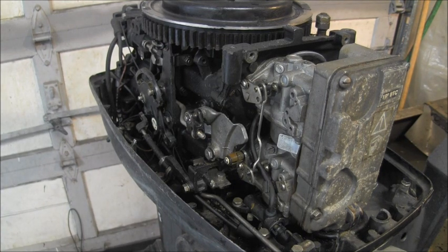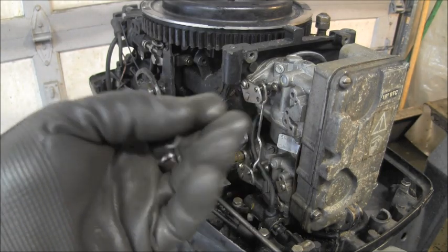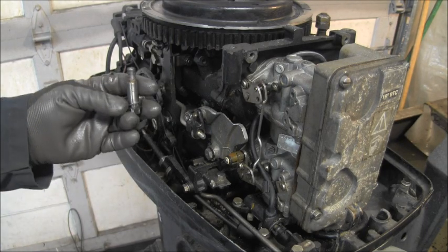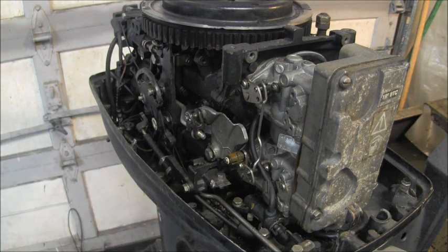And as I got to taking things apart there, right in here, there's what I found for that bushing. Just chunks of it stuck there with hard grease. But it's just completely deteriorated. So I'll get that all cleaned up, and then once I do, I'll take this, I think it's a 5/8 inch bolt, and put some lube on. That bushing looks okay there. I'll replace that bushing, and hopefully that'll take care of this throttle issue.